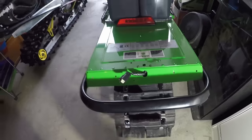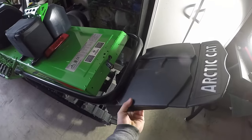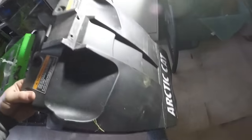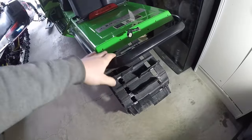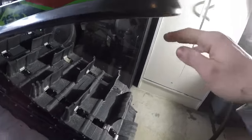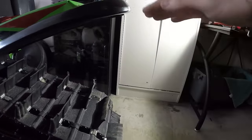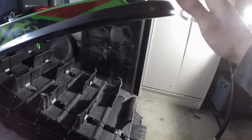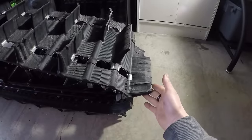Another thing that really bugged me about the Arctic Cat snow flaps is that when your sled is really stuck, the snow flap bends all the way backwards and sits up in the snow, blocking access to both the left and right sides. I'm not a fan of that snow flap for that reason. Also, when backing off a steep deck or trailer, the suspension squats down so far that the bumper drops much lower, and the snow flap can wrap around the bottom of the track and cause it to stop spinning.